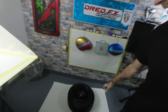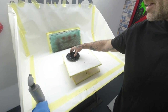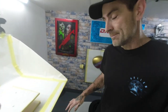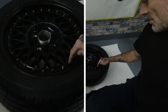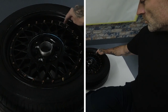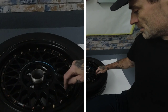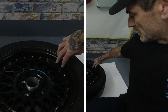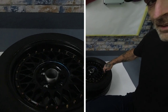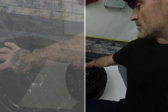These wheels come with a centre cap, so you have a big bolt cap in the centre. Those bits have been cleaned down, and you've got loads of tiny little bolts that go all the way around the rim, so we've got to mask off all these. We're going to paint these first, then mask them off. We've got to paint this lip of the rim, and then we're going to do metal flake on the internal — this lip will be a different colour so it'll be two-tone.